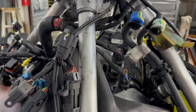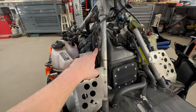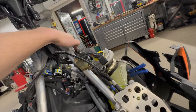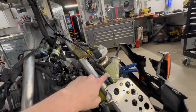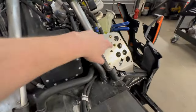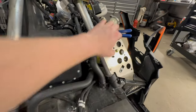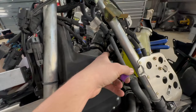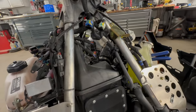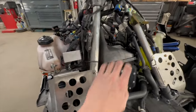As I mentioned in my 650 video, this main harness here comes down to this connector, and then down to these on this side, runs over, goes to the actuator solenoid for the wastegate. I'm going to unplug all of this and move this entire bundle out and up. There's a connector buried behind here. I'll undo the coolant jug, which will hopefully give me a little bit more room. Unplug your fuel pressure sensor and then a couple others over here, and then this whole snarl should pull right out and go up front — that way I have the most room to get this airbox out.